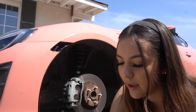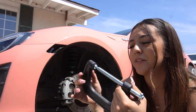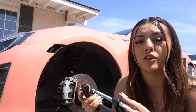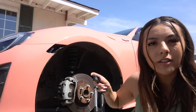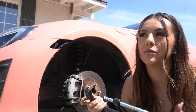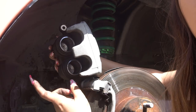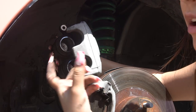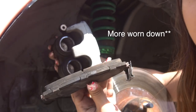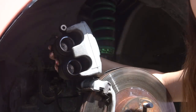Now that I have that — I guess I should have compressed the piston first. I do have a C-clamp. I got this at Home Depot, it was probably like $10. This is a four inch one. I was reading people used six inch but the six inch just looked really big — I feel like this is a perfect size. You could probably find this at AutoZone or if you don't want to buy them I'm pretty sure AutoZone rents them out. So basically what you want to do is compress these pistons. They're popped out a little bit because these brake pads are much shorter — they adjust to that length. But with the new brake pads they're way thicker, so you need to push them in or else the whole caliper is not going to close.